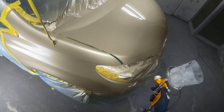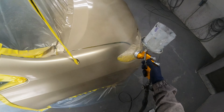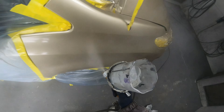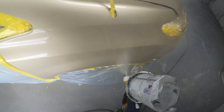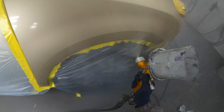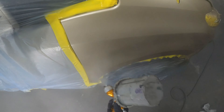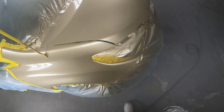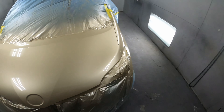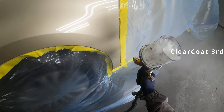You can see putting down this clear — you don't see any blend on those fenders or anything. It all came out pretty nice in my opinion. That first color I mixed up would have been a little too light, and it might have blended out just fine, but I didn't want to risk it — I don't like doing jobs over. The blend didn't come out quite perfectly, but it's an older van and most people don't really complain on an older van. It had damage all over this car — somebody else hit them in the front end so they got this fixed.